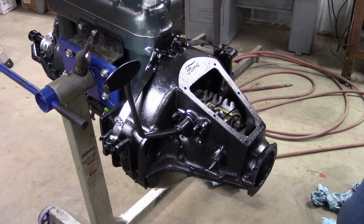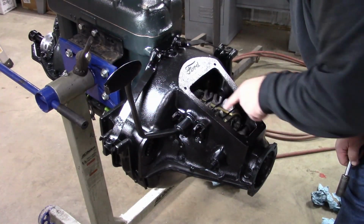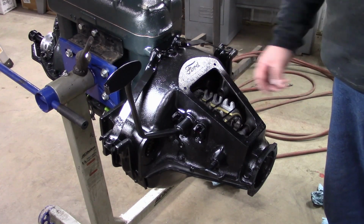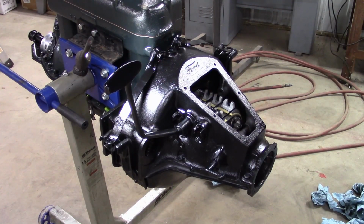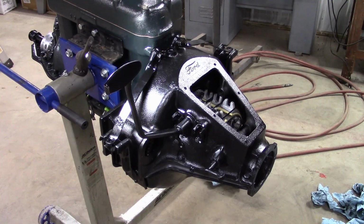So there we go. Hogshead is on, the clutch arm is engaged, the pedal here for the clutch pedal is just started in there. Next thing we'll do is work on putting the springs and the other pedals in, and then do a preliminary adjustment, put the cap on, and then we'll move on to the generator. Then we'll put on the intake and exhaust manifolds, and that's about all we can do with it on the stand, because the stand is in the way of doing the starter.